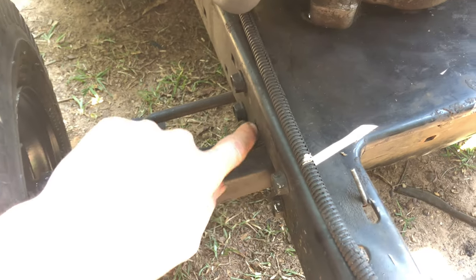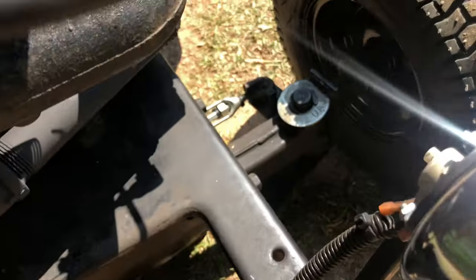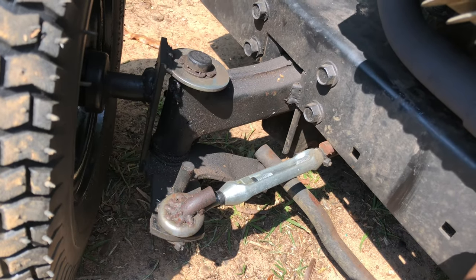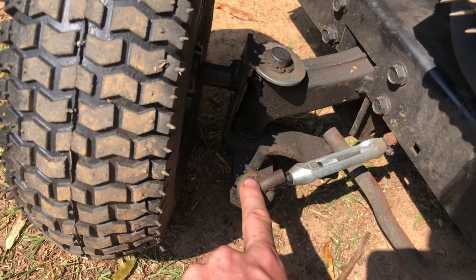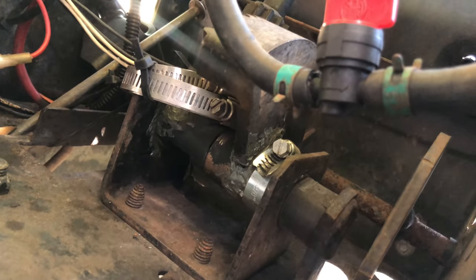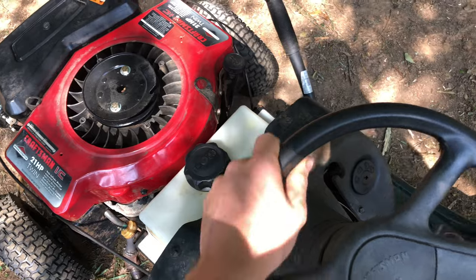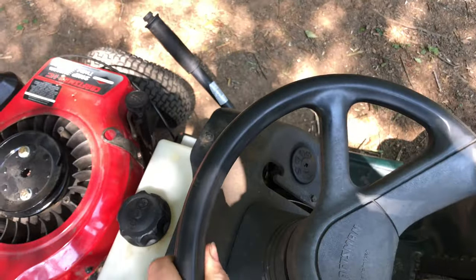Looking at the front axle, I cut a slot in there, raised the axle up, drilled a new hole so the whole axle sits higher, and welded it in place — same on both sides. You can see that's an adjustable tie rod I customized and welded on. I had to buy a replacement piece after bending it on a rock, cut it off, slid it over, and welded it together. You can turn it to adjust toe-in and toe-out. The steering has the first-generation setup — I've modified it quite a bit, but there's still some play. The tie rod ends are a little loose and I'll need to remake the steering, but it works pretty well for what it is.